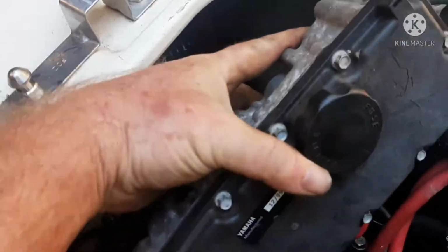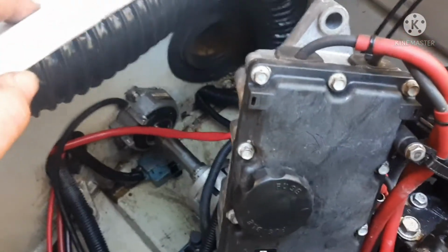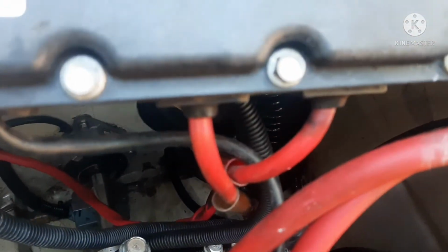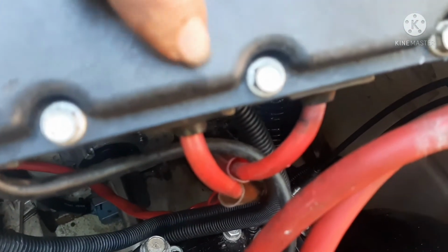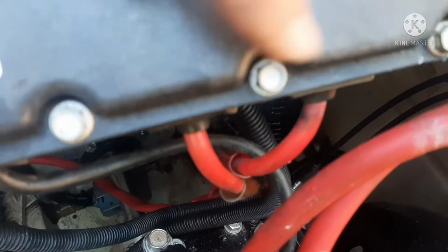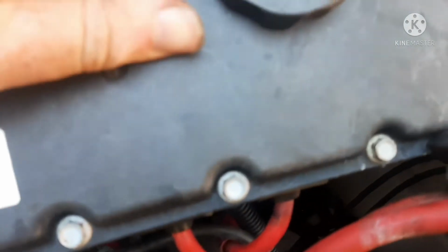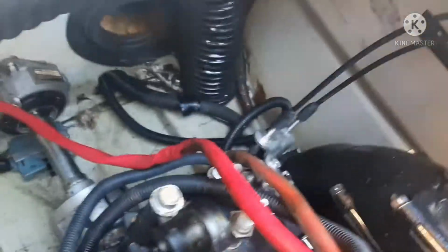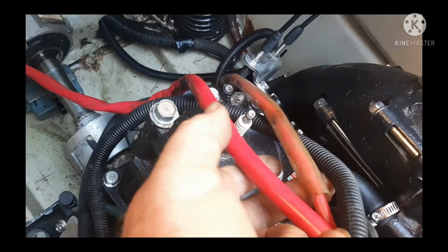That's how it all goes back together, in case you forgot and have no reference to go with, and I'll move on to the next step. And I will say, these 2 wires at the bottom, the thing that confused me is it would seem like battery would be on the side where the battery was, but it's not. That side goes to the starter. This is how it sits. And then this side goes to the battery, so they're crossed. But it's easy to tell with the covering that they have over the wire. Red covering battery, clear covering starter.